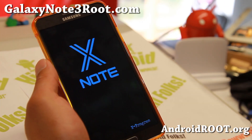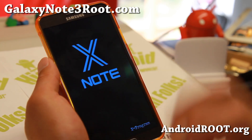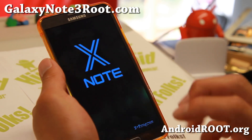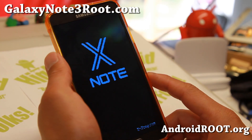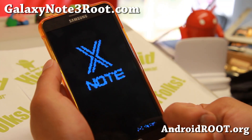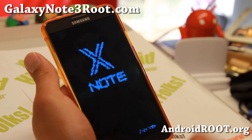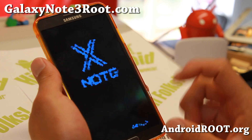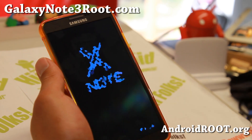This should boot within the next minute or two. Hopefully it won't end up in a boot loop, but usually when you see the custom boot animations, you are good to go. Also, I forgot to note: there are times when you can install ROMs without doing a data wipe factory reset — that is when you are installing a ROM based on the same firmware. You can try it first, which will keep your apps and settings. Just make a backup ROM before you do, and if you end up in a boot loop, then go ahead and do the data wipe factory reset and install the ROM.